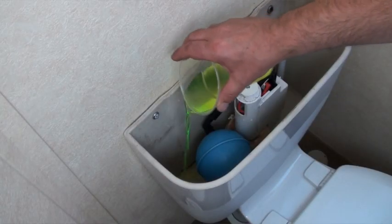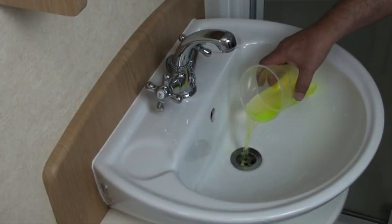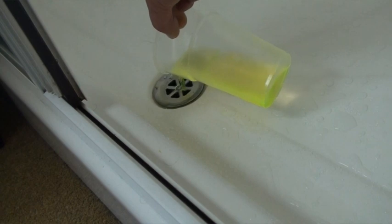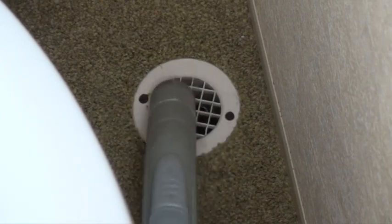The bathroom is a naturally damp place and we don't want to add to its trouble during winter. When you come down to check on the van, look out for signs of mildew and use mildew remover if needed. Flush the toilet and get antifreeze down into the cistern and bowl. Leave the sink and shower taps open and get antifreeze down into the plug holes. Also hoover the floor vents to ensure clean airflow, and leave blinds in the open position to allow sunlight through.